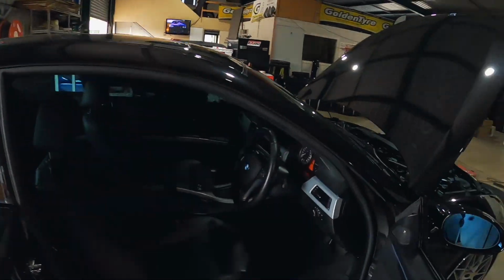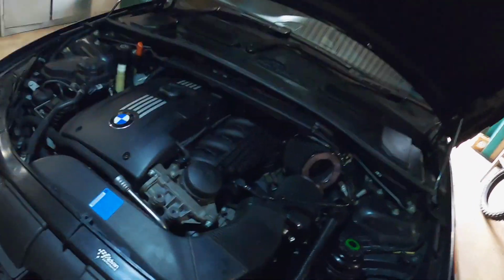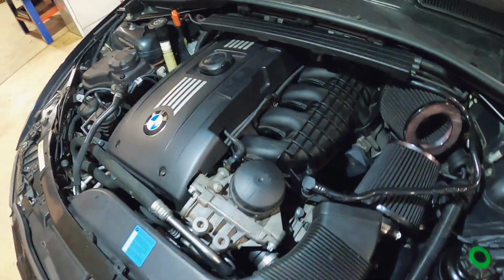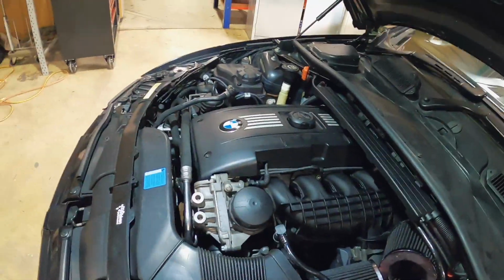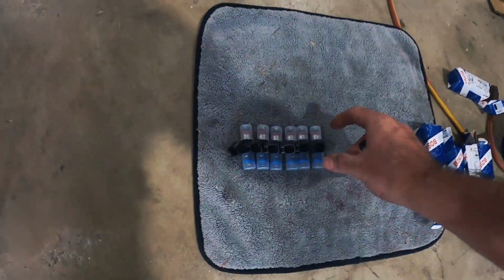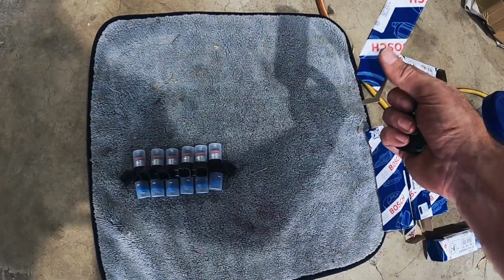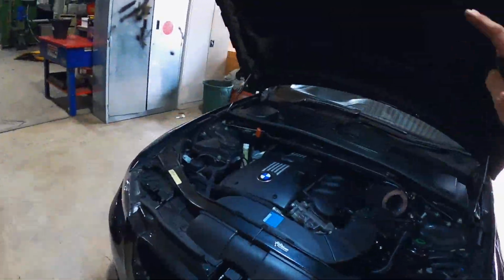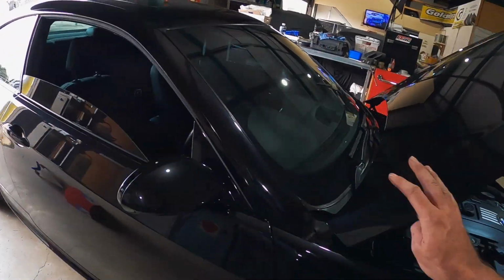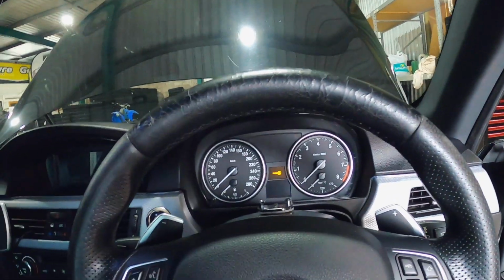Seems okay. Give me a few minutes, I'm just going to check everything's all right, and I'll give you an update then. Thank you. So it's all back together. The only thing that I really don't like is those O-rings on that spacer plate for the port injector. It's just horrible. It really makes me realise I need to get a proper intake manifold. They are the old, leaky, cheap injectors, and they were about 1/3 of the price of these cheap Bosch ones, because these were like $25 each. They were cheap, but no good over 40 PSI. Anyway, that has been sitting for probably about 10 or 15 minutes. So let's see how she starts now.